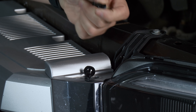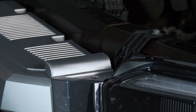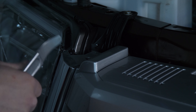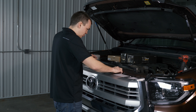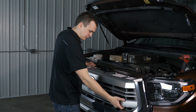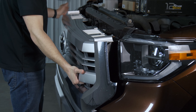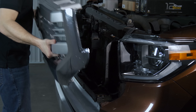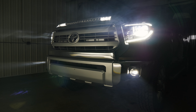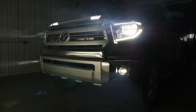Pry it up and yank it out of there. As you can see, this one's a little beat up — it's been off a few times. Do the same thing on the passenger side and the grill is ready to come off. Go ahead and pull the grill upward toward you, you'll feel it kind of come loose. Grab down here, give it a little pop toward you and it comes off. Set it off to the side.